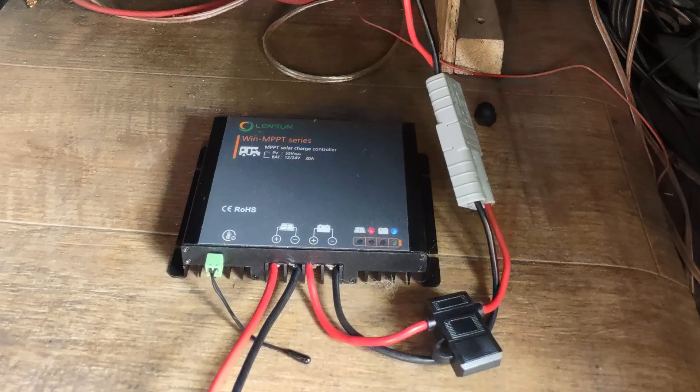Welcome back — I've got the drawers pulled out to get into the electrical cabinet. I wanted to show you the heart of the system: the MPPT solar controller that comes with this 300-watt panel. Just having a great panel is nothing without converting that 22 volts into usable power. I have it set on a lithium profile to charge the house batteries. I love that I can switch it back to AGM — if everything's dead, house batteries out, truck won't start, I take the 50-foot extension cord, run it out, clip it onto the truck battery, and I'm on my way.